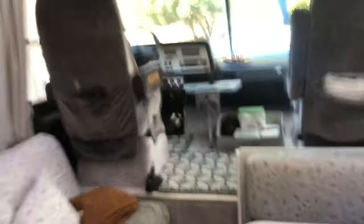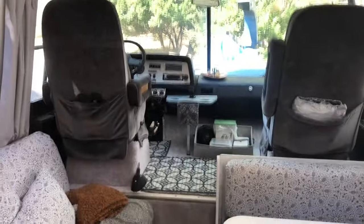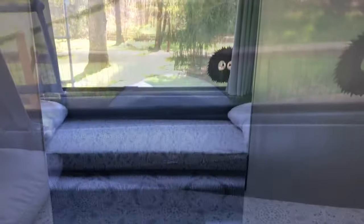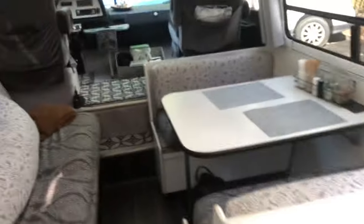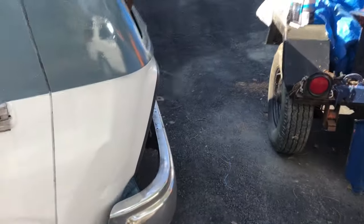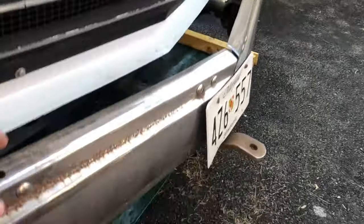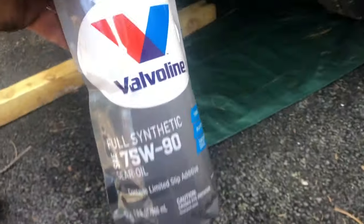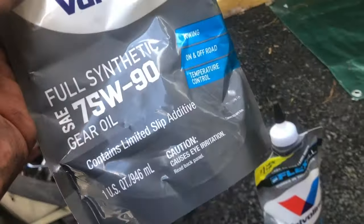We're all put back together. We are going to air up the tires and air up the one airbag to get it into traveling mode. After our trip last fall, we had our new final drive ratio, and we're going to drain it and put some fresh fluid in it because we haven't done that yet. You can see we put our new aluminum cover on there — I can actually drain it with the drain plug, which will be nice. Using these squeezy things for the differential; they work great.